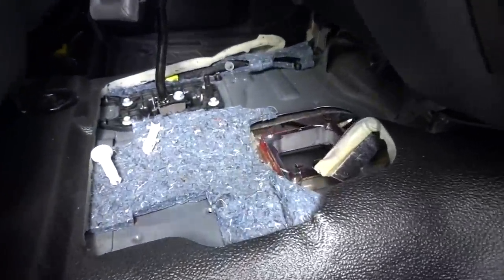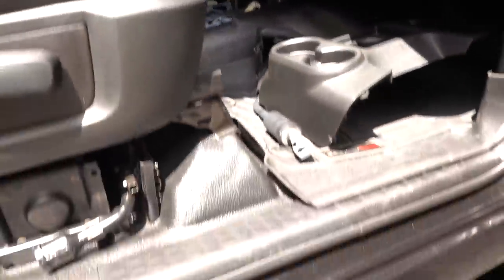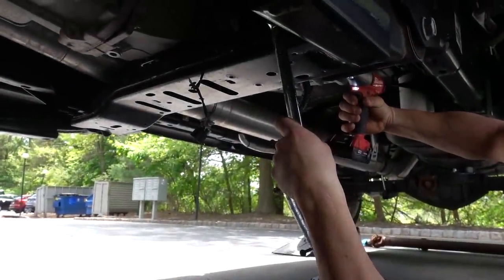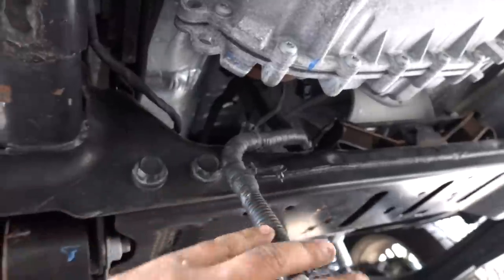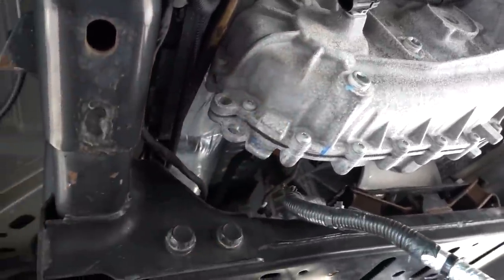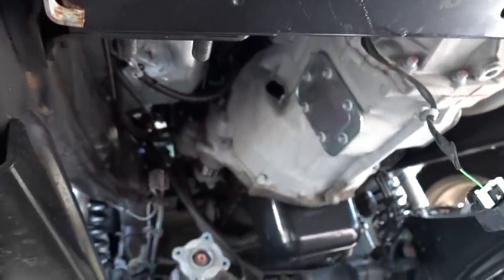All right guys, we are pretty much almost ready to come out with the transmission. Andy went ahead and got all of the interior pieces out. We're going to stuff a rag in there to make sure nothing gets down inside, but had to take the whole shift tower out. Andy's working on the cross member. Underneath here we got the drive shafts out of the way, all of the harness plugs removed from the transmission, and the shift lever off. We're going to pull the trans with the transfer case on, which is sometimes a pain but that's what we're going to do. Got the hydraulics out of here — just got to pull these cross member bolts out and do the bell housing bolts once we get the trans jack in.